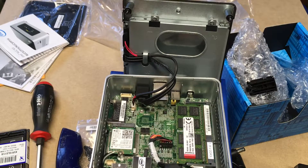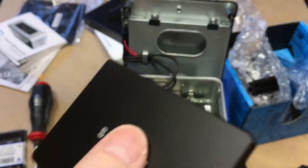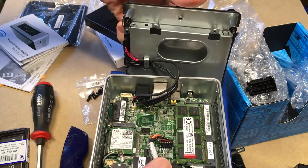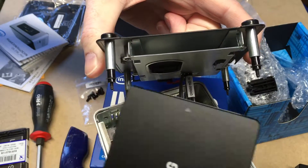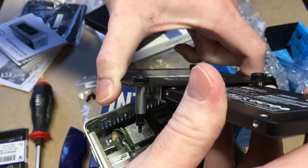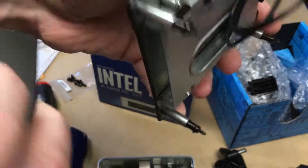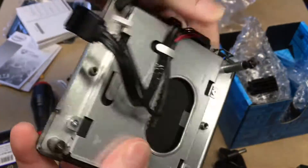Now I'll install the hard drive. If you've never used one of these SSDs, they're tiny, super thin, and very lightweight. I'm going to orient this hard drive so the SATA connector lines up. I'll detach this so I can get a better hold on it — these little tabs here create friction when you stick this in. It appears I need to hold this down with my thumb while I press it in, and then it goes in easily.